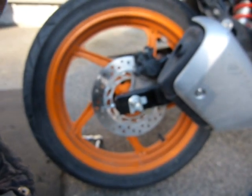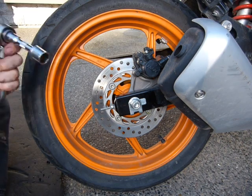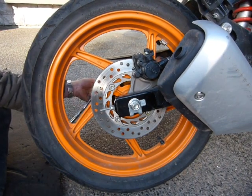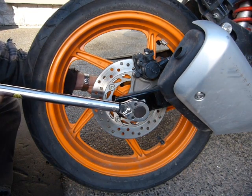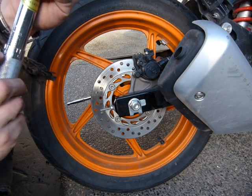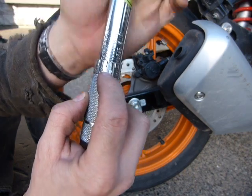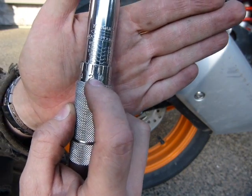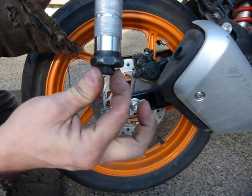Wait for the camera to focus, then put your 17mm wrench on the left side of the bike and the 22mm wrench on the torque wrench. The specified torque is 51 pounds-foot — I know I said pounds-foot; most of you might call it foot-pounds, but the correct name is pounds-foot. 51 is set — you can see it on the handle.